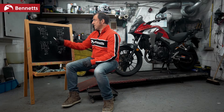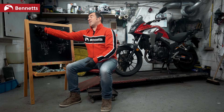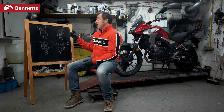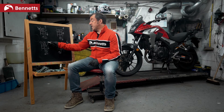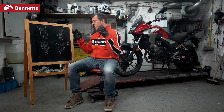However, there are problems. If we create a bigger explosion, we could damage the top of the cylinder head. If we get a huge amount of fuel and air in, we still must get rid of it — this is going to have problems with Euro 4 and Euro 5 emissions. If we're increasing the amount of fuel going in, we're going to have to increase our tank range because fuel efficiency drops and testers will complain. If we reduce weight, we reduce strength — if we make the conrod out of really thin material, the conrod might snap. If we increase the speed, we increase the temperature, and if we increase the temperature we need to add cooling: water cooling, oil cooling, or larger fins if it's air cooled. It's not always that straightforward and engineers are going through this constantly.